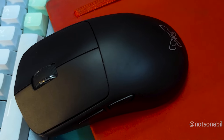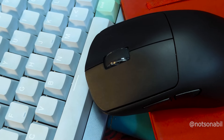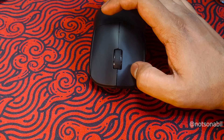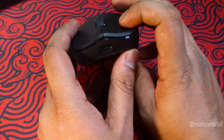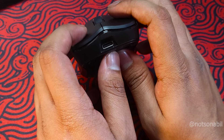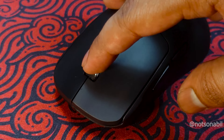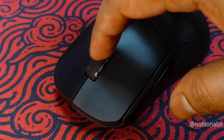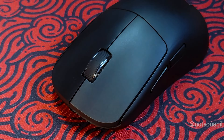For switches, the mouse is equipped with Kailh GM 8.0 switches, also known as Black Mamba switches, rated for 80 million clicks lifetime. The left click has no pre-travel and the right click has only a very slight pre-travel. The side buttons have absolutely zero pre-travel. The scroll wheel is equipped with a Kailh GE 2.0, which is a reliable and smooth-feeling wheel that doesn't strain your finger, and has decent tactility when middle-clicking.